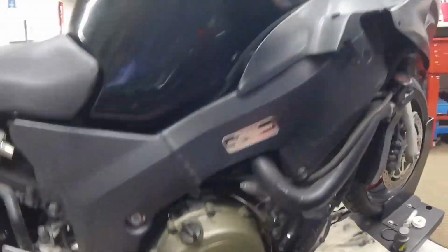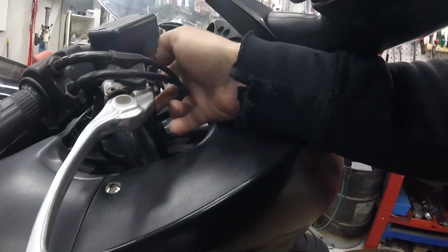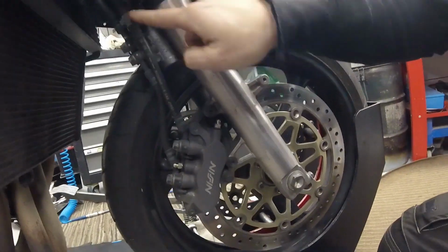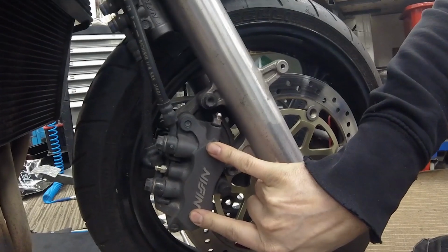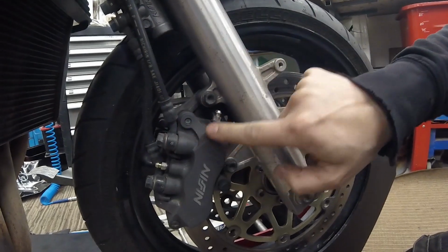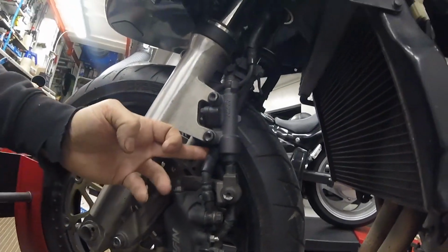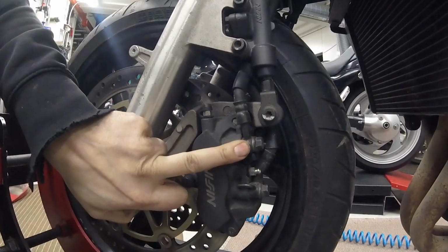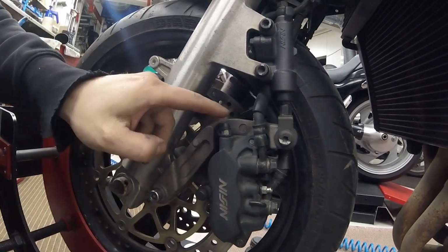brake fluid container is here, and the front brake is easy, the container is here at the master cylinder, the hose is going down here and it comes down to here. So the front brakes use these two pistons here, and the rear brake presses this middle one here. So these hoses come to here and this nipple is for the front. Same at the other side. Here, this is the hose that comes from the other side, and it's the same thing here with these two pistons, and the bleeding nipple is here.